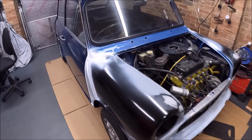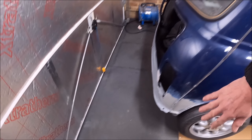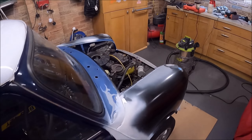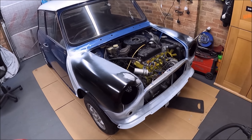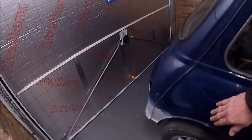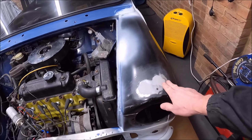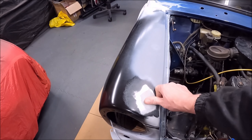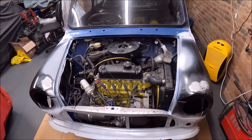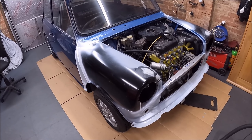So I'm prepping paintwork at the moment. The back corners have probably had two or three goes at filling because I sort of fill them, rub them back, and I can feel it's still not quite right. But as I've done them now, I'm feeling quite happy with it — it's just had a final skim with very fine filler. And at the front here, as I was going over the panels again, I found a couple of tiny little dents which are filled. This fine filler is just waiting to be rubbed down. Once you put gloss on there it will show up any imperfections — hopefully I've caught them all.